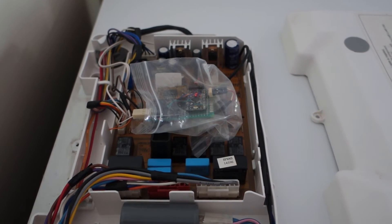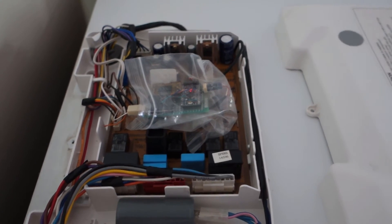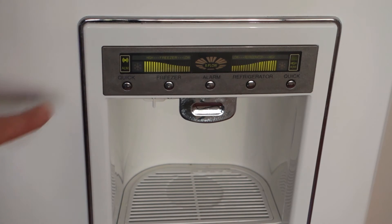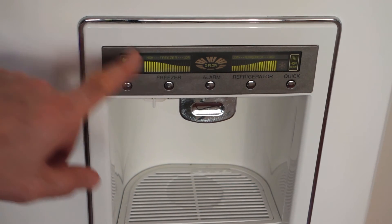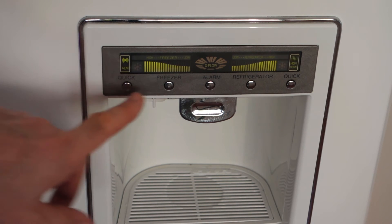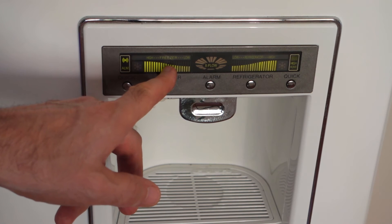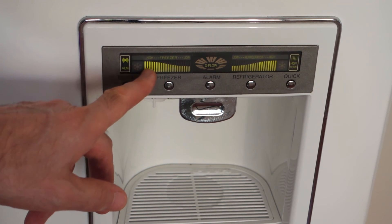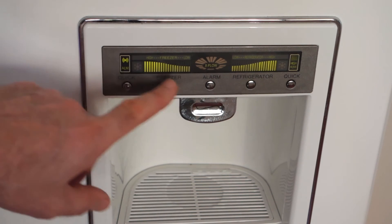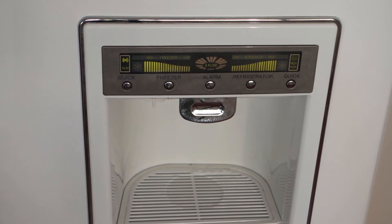Just to demonstrate that, I'll put the camera on the tripod pointing at the front of the fridge and show you what happens when the power goes off and then back on again. With all the LEDs lit it's on maximum at the moment. I'm going to power the fridge off, and when I cycle the power back on again it will briefly come up to the midpoint temperature — that's its default — and then you'll see the Arduino very quickly boot up and issue two button press commands, for both the fridge and the freezer, to crank it back up to maximum. Here we go — power off and then power back on again — and as you can see, very quickly back up to maximum temperature.